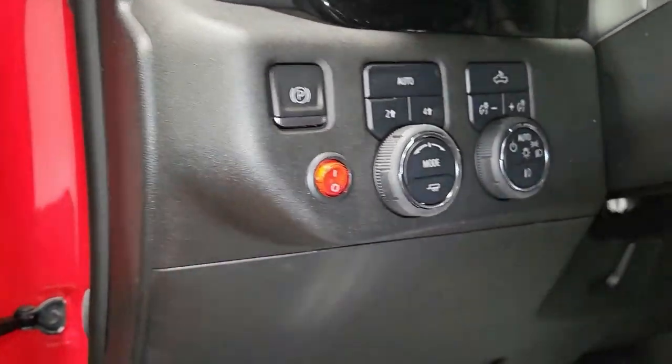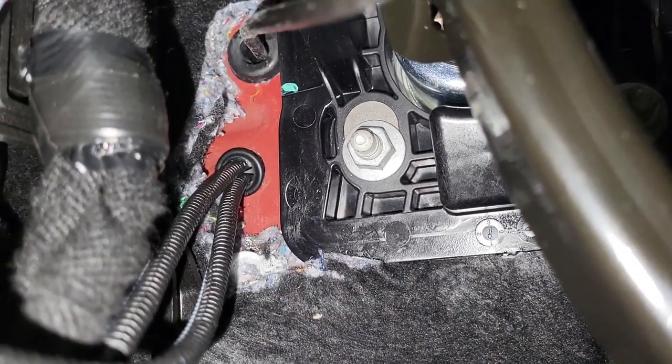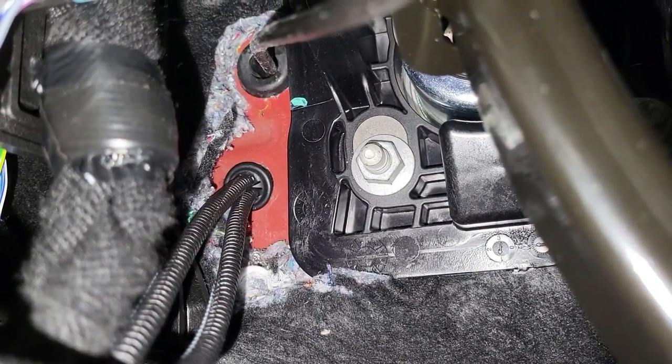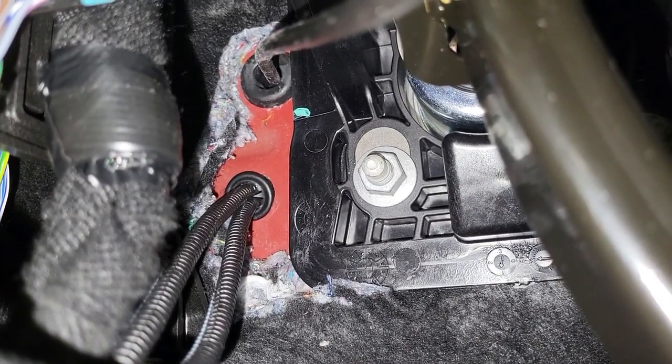This panel is kind of a pain in the butt though — I didn't take that one off. I just took the one below it. Let me show you down under here where you're going to need to drill the firewall on this truck. Where we went through is right there — I like that spot. Do be careful. That's a three-quarter inch grommet right there, and that's where we drilled and brought both of those grille lines right through it.